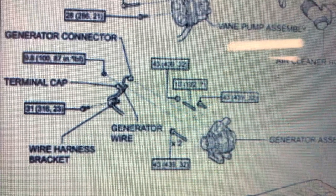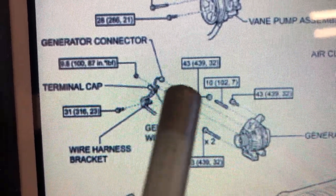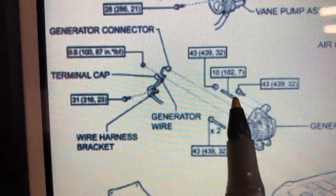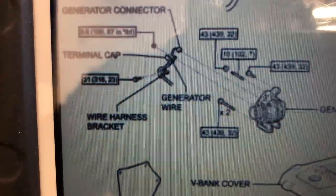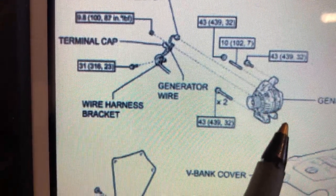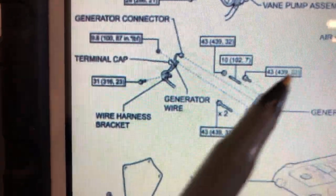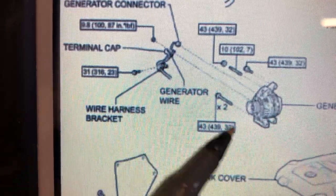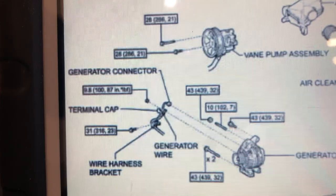The upper nut at the top of the alternator towards the front is 43 Newton meters. So anything that mounts this alternator: the bolt at the rear is 43, the nut at the front is 43, and the two lower ones are 43. You'll also want to leave the rear bolt in when it's coming out — it's kind of hard to get out, so leave it in the alternator, get it almost all the way out, then remove it and reverse that on installation. Anything mounting the alternator: 43 Newton meters. 31 for the little bracket screw on the front of the alternator, and 28 for the power steering pump.